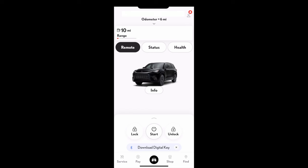Your engine will still be running. If the battery on the vehicle is not working, use the mechanical key to unlock the vehicle, but you will not be able to use the digital latch to open the door handle. Unlock the door, then use this emergency mechanical latch — pull toward you and then open the door. When you're ready, contact roadside assistance. To put everything back together, replace the cover for the key cylinder. Remember there are two pieces — insert the back piece first, then snap down. Then return the metal key to the key fob housing.